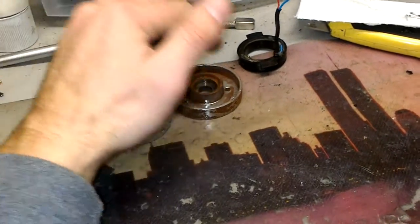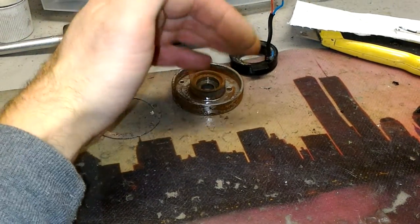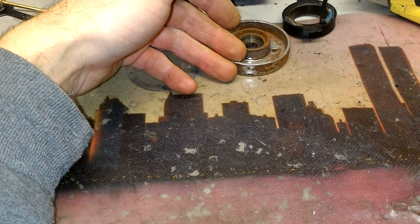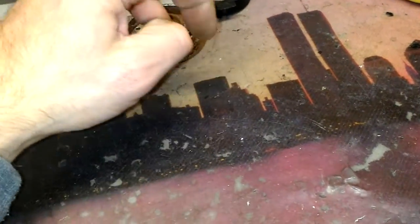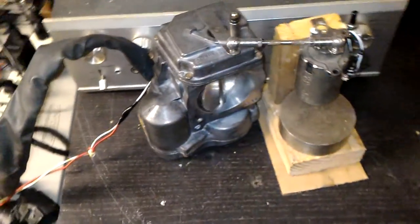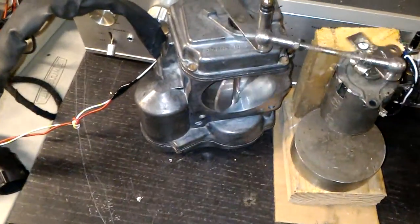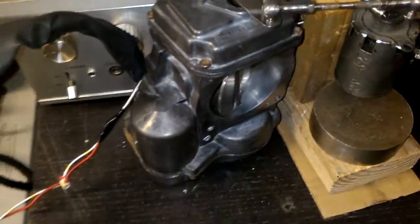So this is basically all cleaned up. I installed another coil holder, cleaned up everything — the whole casing, flushed the motor so it's nice and clean with no residue. Put everything back together, put in a used coil, then opened up the potentiometer, cleaned inside and outside, blew it all out, and ground out all the oxidation. As you can see it works and I have no problems with this unit. Beside the rust, it cleaned up well — pretty nice and shiny. Sometimes oxidation cannot be removed, but this one came out nice.